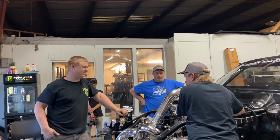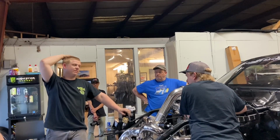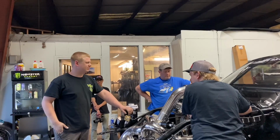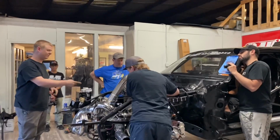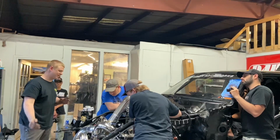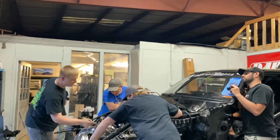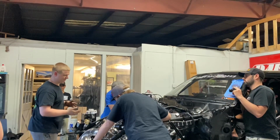Right, but somehow totally ignoring the cam. Even when I tried it in batch with it pretending the cam wasn't even there, it was still reading the same thing. So what if we just moved the balancer reluctor? Just imagine we got this thing in batch, and it's reading 195 like it was when we started, and we moved this so that it finally read 12 like it should have, and then see what it does then.